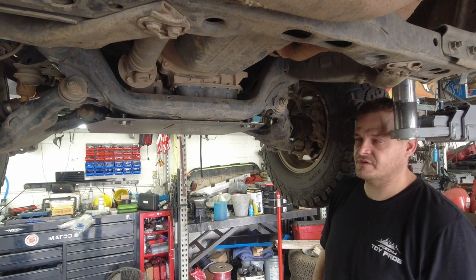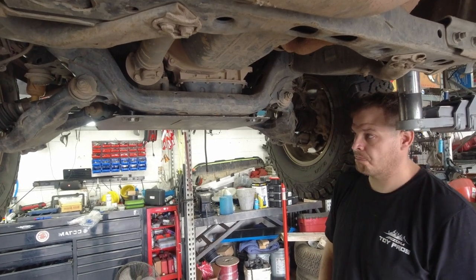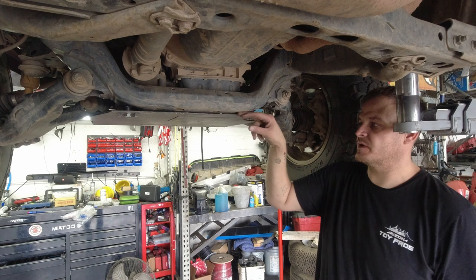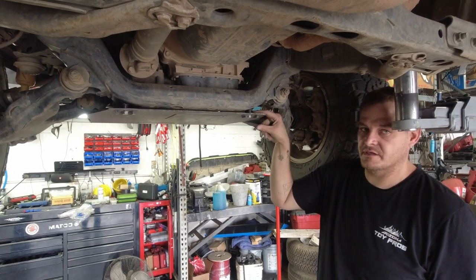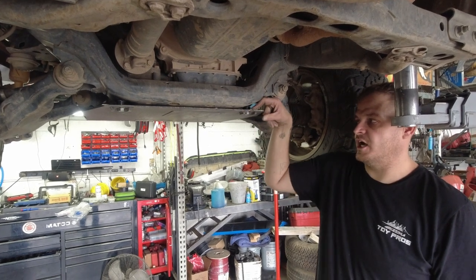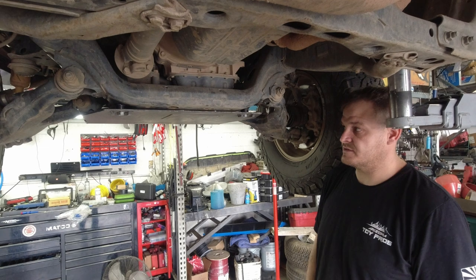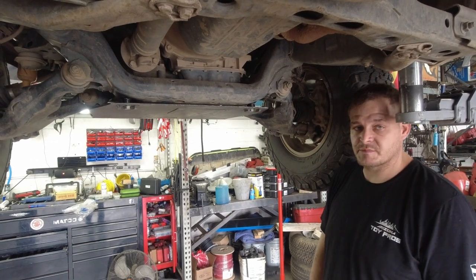They shouldn't strip the threads if you do it gingerly. We put spacers in there too to get it down off of the cross member and off of the diff. Where these nuts sit is a little bit higher than this part of the cross member, so if anything it'll be stretching bolts and that's where they pop and break. So you have to run a spacer on the rears so you're not cranking the skid plate up trying to tighten it — it's actually just tightened at the tight points. I like to do a little bit thicker spacers so that you have some drainage, and with your diff drop it clears it as well. We also did the same thing in the front just for some clearance.